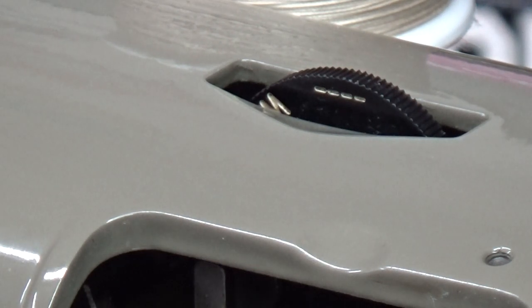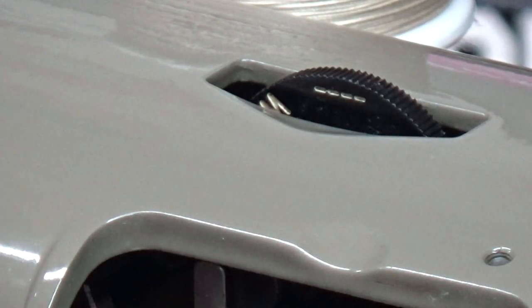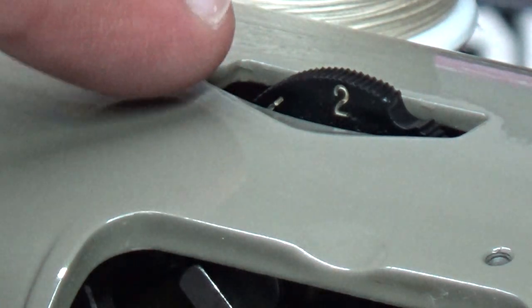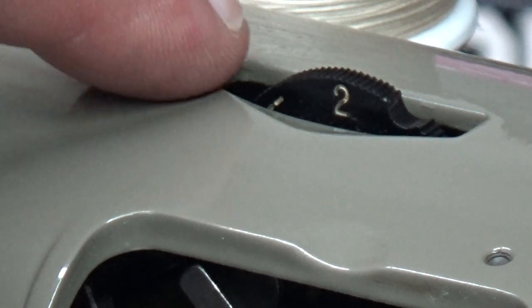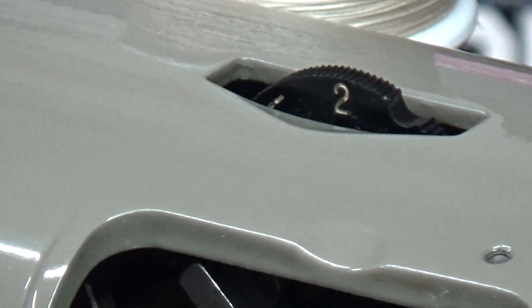So right now we're on straight stitch, which is where I wanted to be, but we're going to go away from there for a reason. In order to insert a cam or to remove a cam from this machine, you have to be on one of two settings. So I'm going to start rotating this to the left. Right now we're on number two, which if we were going to sew this cam E, it would give us this stitch output, because the side that faces out on these cams when they're inserted is side number two. And you cannot remove or insert a cam when you're set in position two. I have my screen the wrong way, give me a second. You cannot insert or remove a cam when you're on position two. So let's continue rotating it to the left and see what we get next.